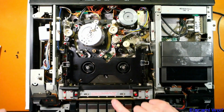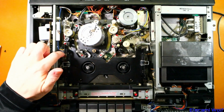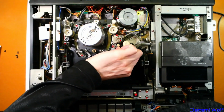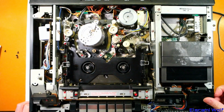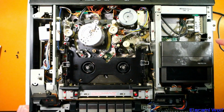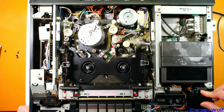Yes, there's a light bulb there, so that's a common fault. The light blows and then won't work anymore because it can't tell when the ends of the tape are reached. Well, that means it should work, shouldn't it? Because it just always thinks there's tape. Ah, look at that. That is that RF modulator selector switch thing. It goes into an actual RF switch with coaxes coming out of it and a long range actuator.